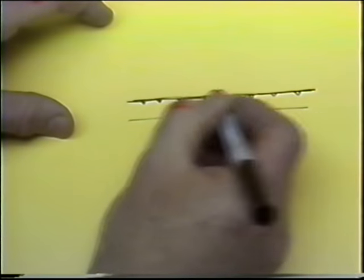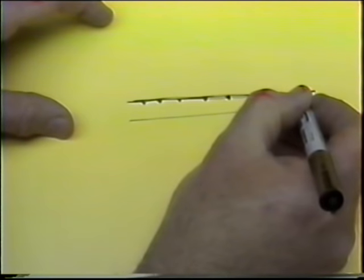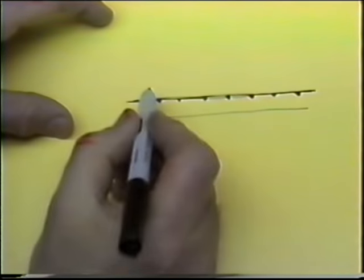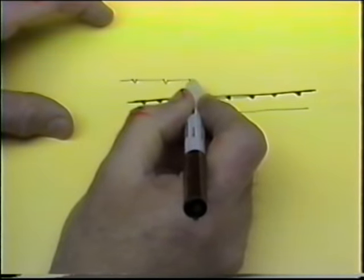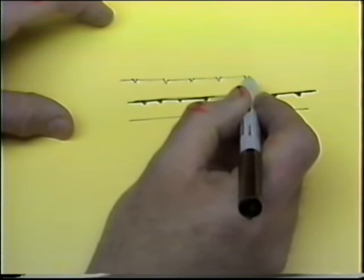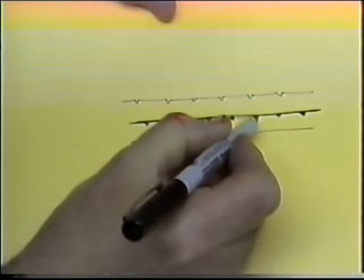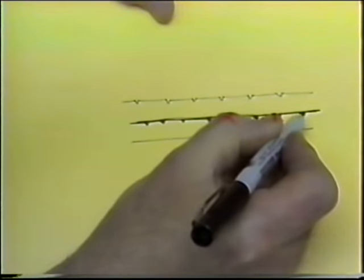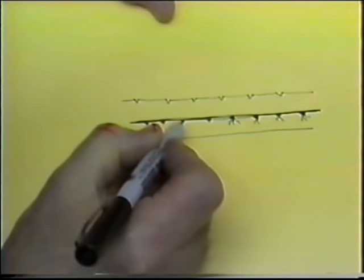I'm sure anybody that's worked with any chemical materials knows what this does. It allows the surface of the primer or the filler or the dope or whatever, even if you're going to use auto primer, to get a tooth. And you wind up with this. It's called a mechanical tooth. It also allows these little areas where the thinner, in our case the retarder, can penetrate.